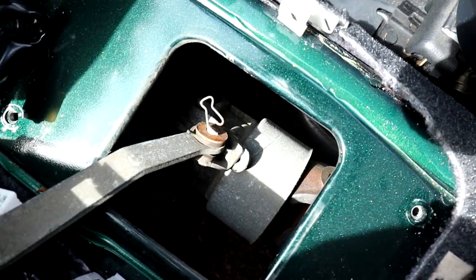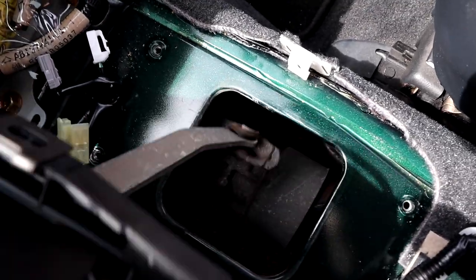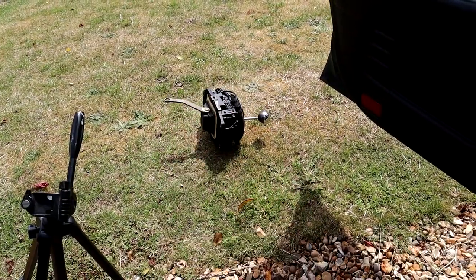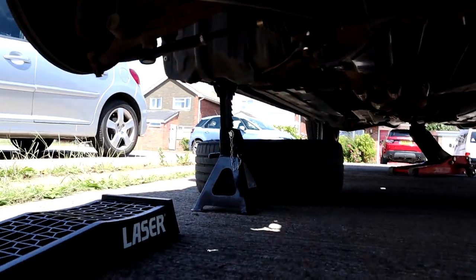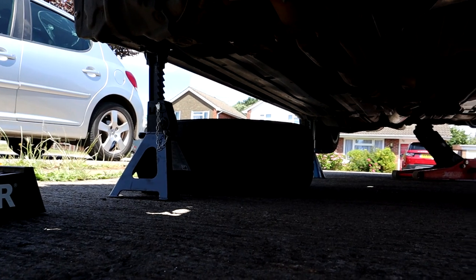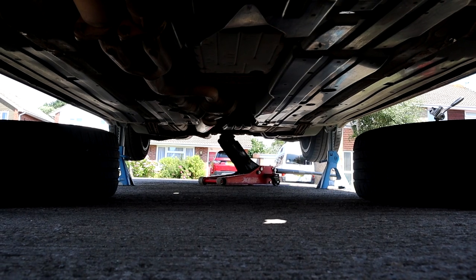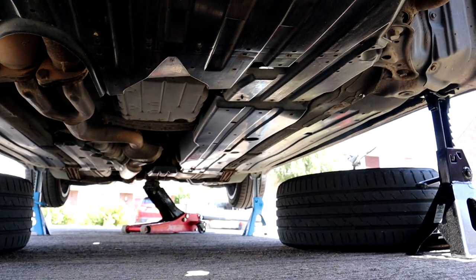It's on an angle so I'll lift it up a bit and wiggle it. There we go — that's it for the inside of the car. Now I'm going to start taking the gearbox out. I've put the car up on four axle stands, and put the front wheels there for extra safety. The jack is still at the back on the diff but I'll probably move that to the front cross member.